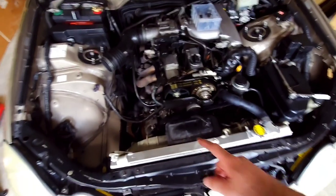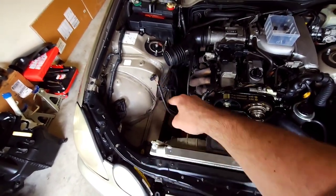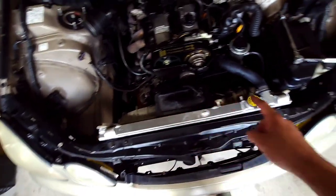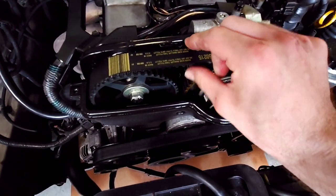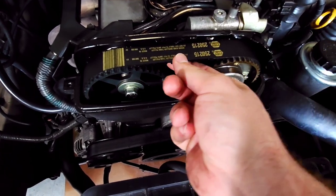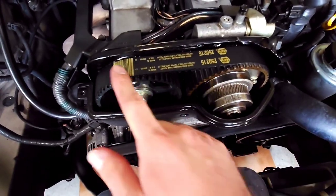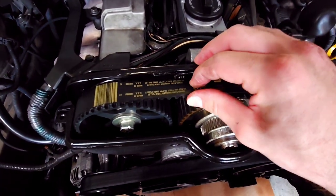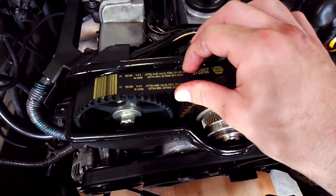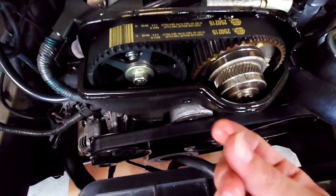So far I just took off the air filter box and the brackets holding the radiator on. It's still a little hot so I'm still letting it cool down. This looks like a brand new belt from Napa — I might need to change that while I'm at it. It's a little tough. It's still got some flexibility and you can still read the lettering, but it almost feels like it's plastic. It's hard to tell. It's got still some rubber-ish material to it.